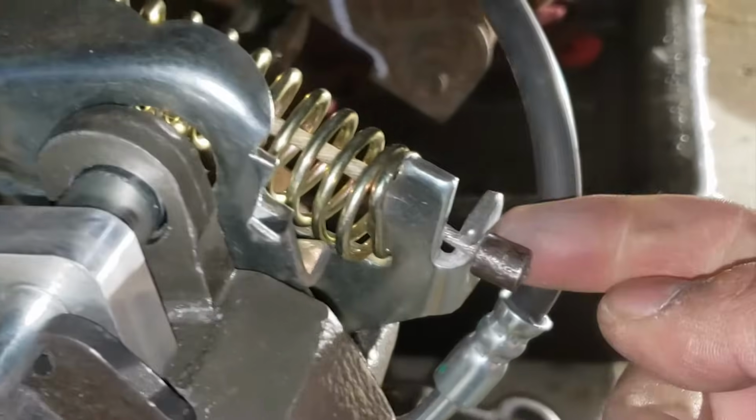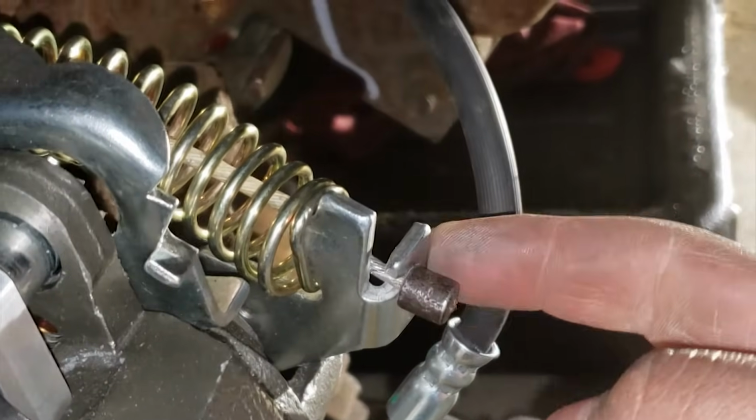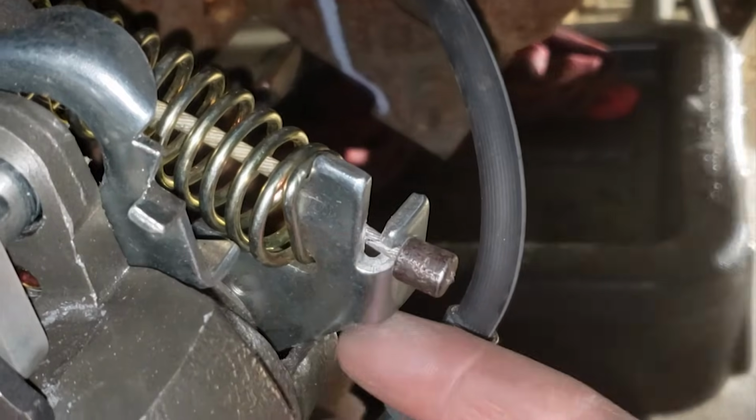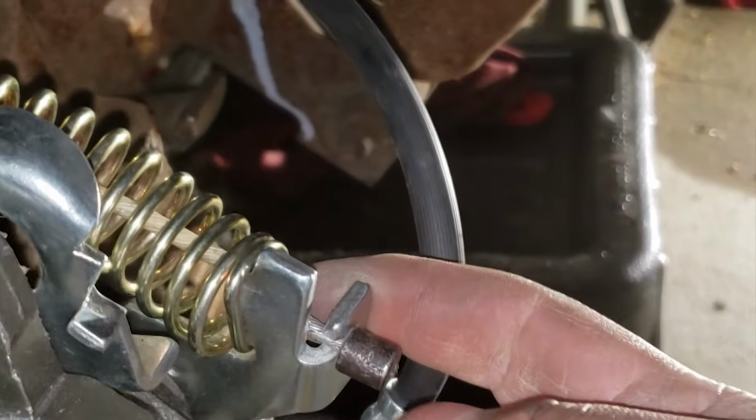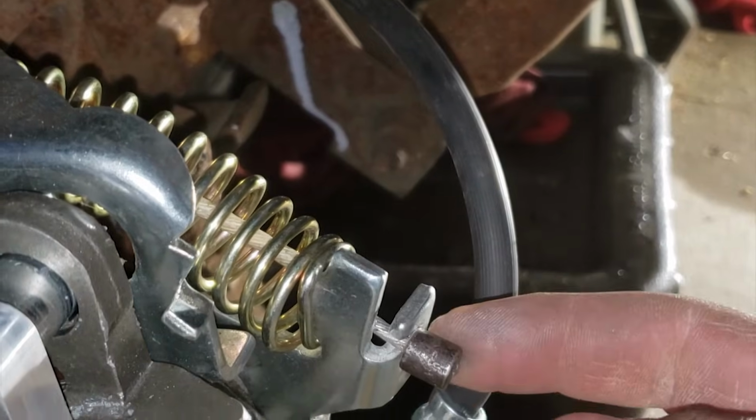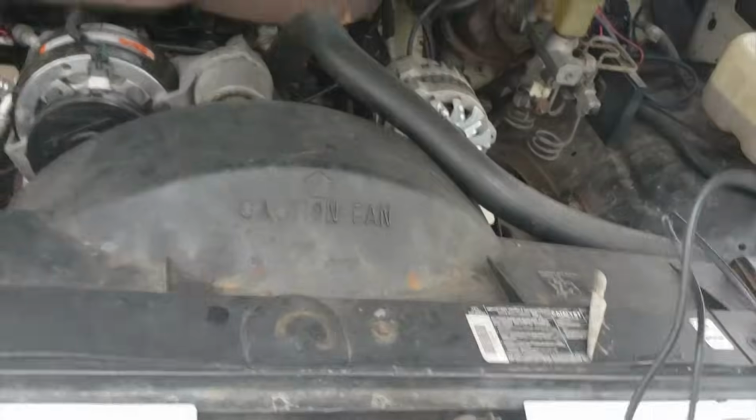The caliper uses a ratcheting mechanism to push out the piston as the brake pads wear out. Remember to use the parking brake pedal when parking the truck, otherwise the mechanism won't work properly over time, resulting in too much travel before engaging. Once both of the parking brake cables have been adjusted, you can start the brake bleeding procedure.